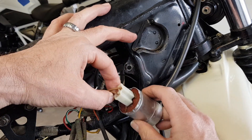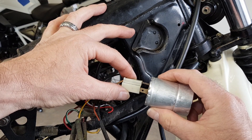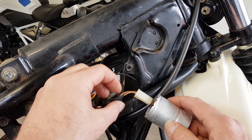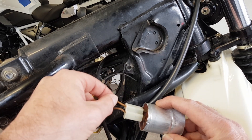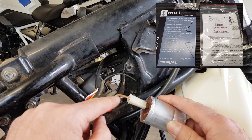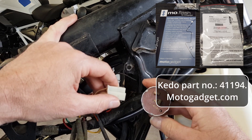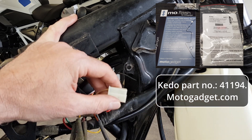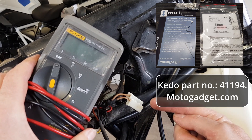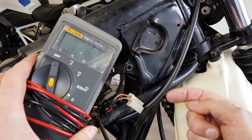We need to make sure we connect it the right way around — if you connect this the wrong way around, you will destroy it. So the B terminal connects to the brown wire, and there's a second wire which is brown and white. The brown wire is your 12-volt feed, which we're going to connect to the red side of the new module. The brown-and-white wire goes to the black cable of the new module.